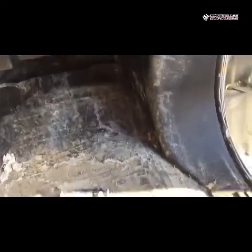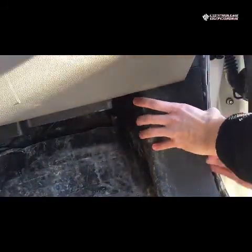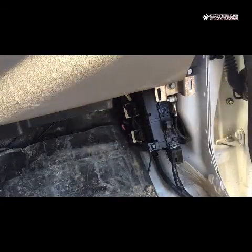You're going to pull this weather stripping back here — this is going to pull this four-piece up a little bit. You're then going to hold that out of the way, snap your pop rivets up top on your panel. Pull that back and also lift up on the four-piece; this is all going to come out like this. You can take the fuse panel piece off first if you want to — you don't have to.